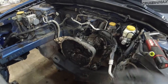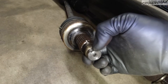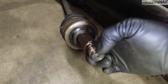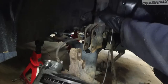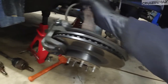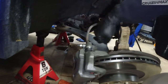First you want to drain the oil, then remove the axle nuts. On each axle on each side there's a kind of cutout — you want to take a punch or a flat punch and tap that nut out so the nut can actually come up. Do it on both sides. Then you want to undo the 19mm nuts and bolts on the strut towers so the knuckle will come towards you. Then you want to push on the axle, tilt it, and remove it.